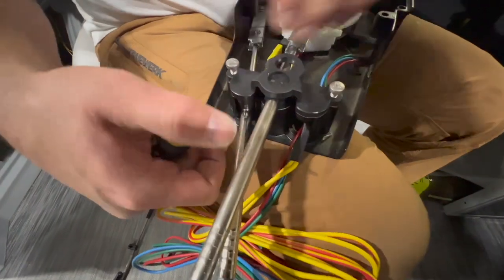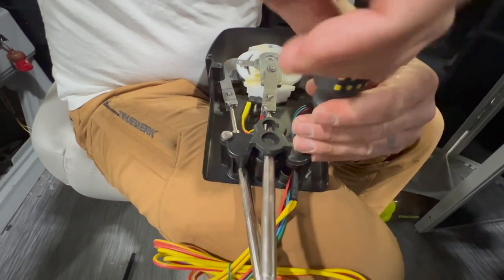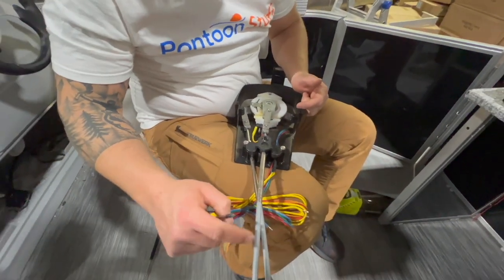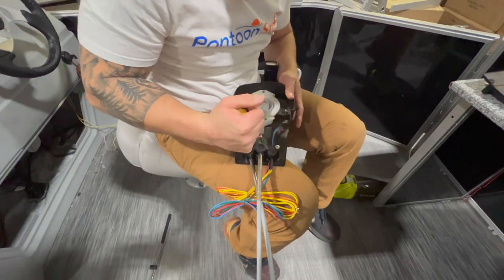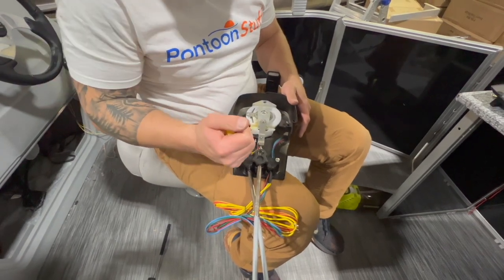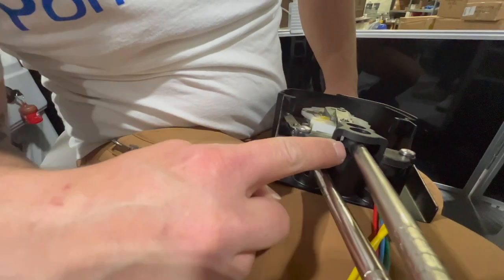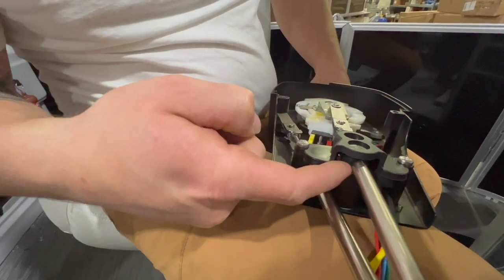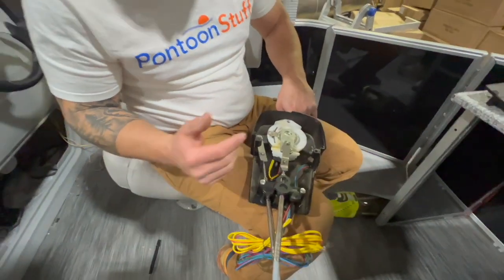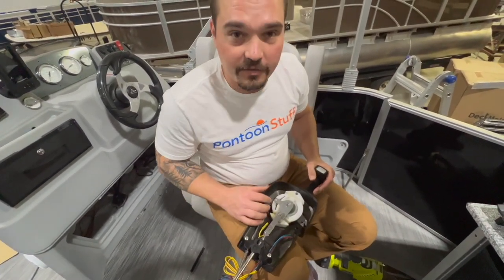When you put this cover on, make sure your throttle cables are pushed into place. The way these cables work is that bullet holds the sheathing in place while the cable itself is a push-pull cable inside that outer sheathing. So the cable moves on the inside of the metal and plastic, and we have to pin the sheathing in place and allow the inside mechanism to move. The bullet for our throttle is in the back space — the only place it can fit — and our shift is on the bottom side to make it pull.